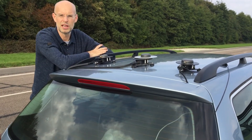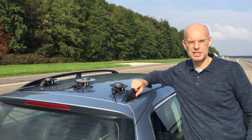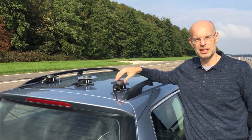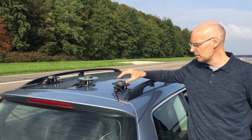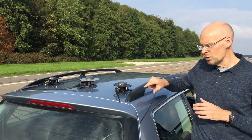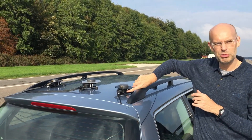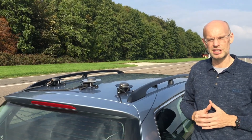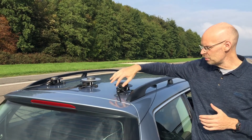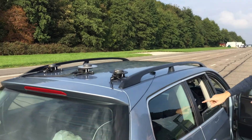This is a full differential 2cm accurate system. On the top of the vehicle we've got the three test systems, and each of the three systems consists of a very high accuracy GPS antenna mounted here. Underneath the antenna we have the IMU, which consists of three gyroscopes and three accelerometers bonded together in a very small package. That's a tactical grade IMU — the highest grade of generally available IMU. The data from both the GPS antenna and the IMU are going down this armoured cable into the car.